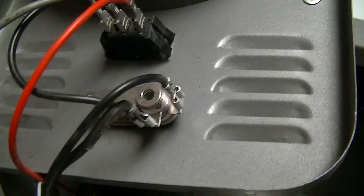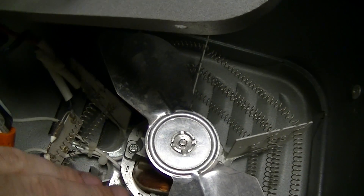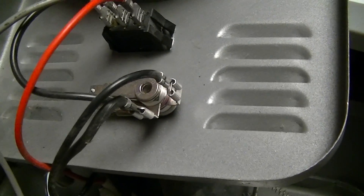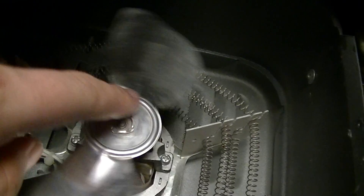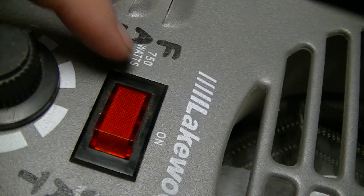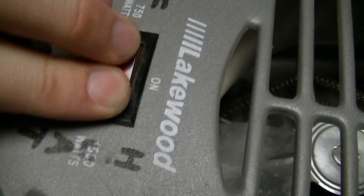It's a fairly simple mod. As a warning, don't fiddle with this stuff when it's live, because this whole element is electrically live and these terminals are all electrically live — just don't fiddle with the stuff if you have absolutely no idea what you're doing. But now it works as either a fan or as a 750W heater, and I just had to remark the front of it as 'fan' or 'heat'. It serves my purposes for now.